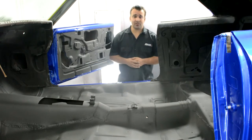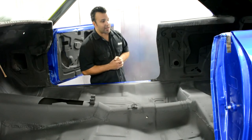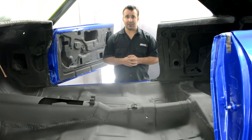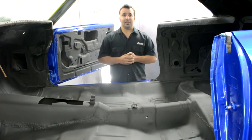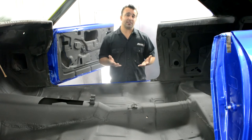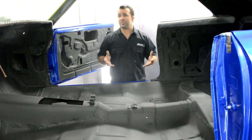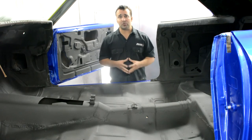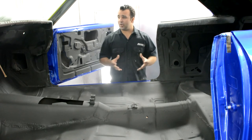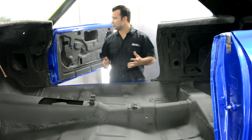We've got it all unmasked and we're finished. It came out great. As you can see, nice straight tape lines, really great coverage, really good coloration — it went on as planned. My tips weren't overly detailed because Heatshield Products has done a great job of making this product extremely user friendly. It's almost impossible to mess up. There are no hardeners, no reducers — all you do is pour it in the gun and spray it. It air dries and takes only about 15 minutes between coats.